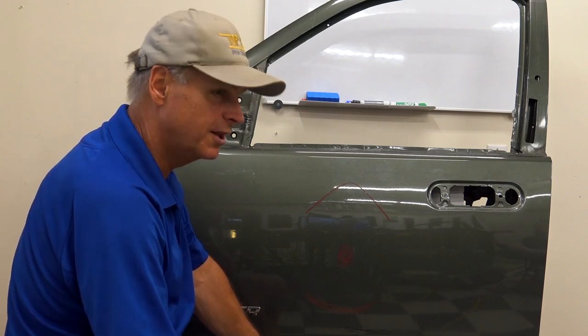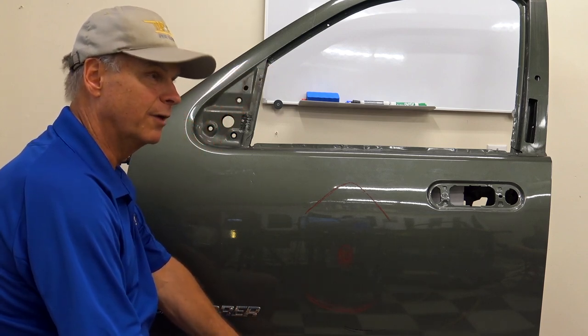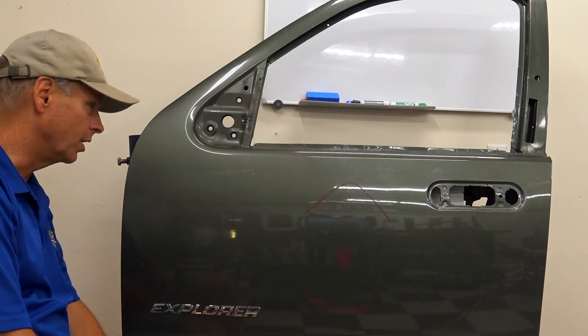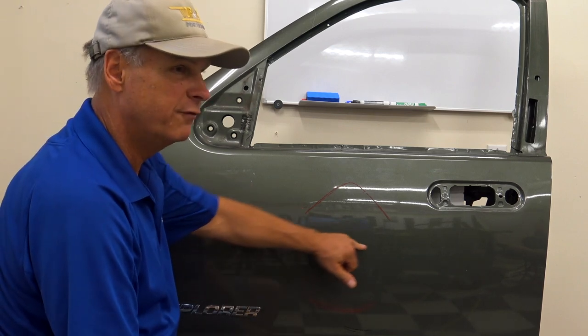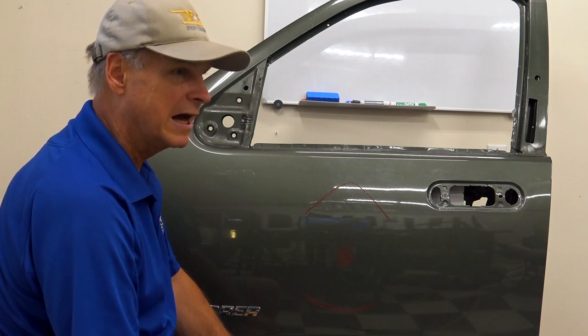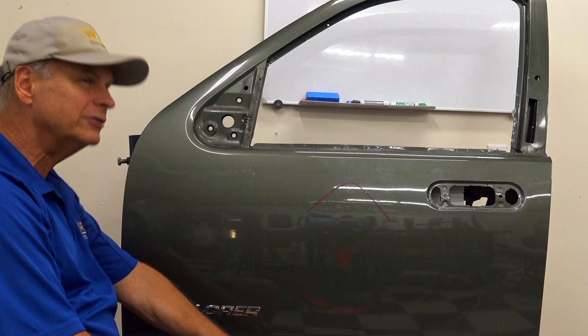I've seen a lot of people that said they were, and then you look at them and go, dude, that ain't even 95. You know, if you can stand 20 feet back in a white picket fence reflection and go through, you see absolutely nothing, you just did a 100% large dent repair. Now, on a 150-degree crown or soft crown, oh yeah, no problem. I've done several 99s and never gotten to 100% yet. Get my head 20 feet back and look at that. There's something.